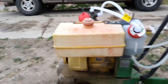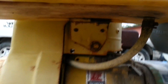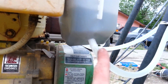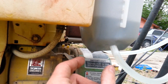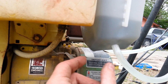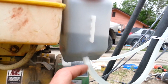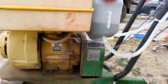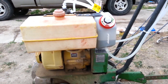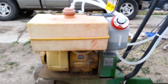What I'm going to do is — this is the fuel tank that came with this tiller, it's an old John Deere tiller — right here at the bottom is where the fuel comes out. What I'm going to do is put a T on this line right here and then a needle valve, which is a valve that allows really fine flow through there. I'm going to tie it into the needle valve and adjust it just right so that it will trickle gasoline in as needed and keep this container at the level that it's at. I'm not going to use a float because I have it stuffed with stainless steel wool — if I just use that needle valve and control the flow that way, it'll work out just fine.